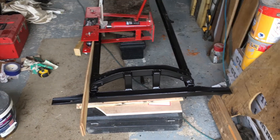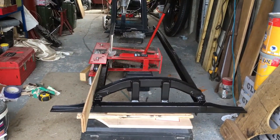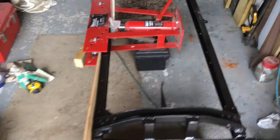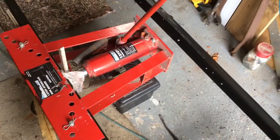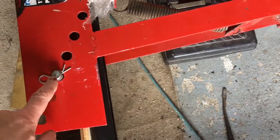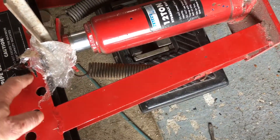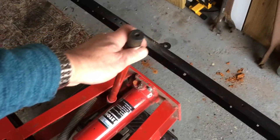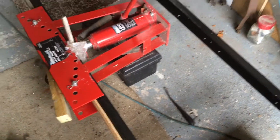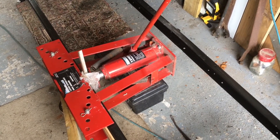I finished painting all the chassis the other day and stepped back and looked down the end and suddenly realised that one of the chassis rails was actually bent inwards, which is a little bit annoying to find out after you've painted everything. I've come up with this idea for strengthening it — I've got my standard tube bender here acting onto the inside of the chassis rail, with some wood plates to protect the paint. This pushes up and hopefully will straighten it up — you just pump on the handle like this, and I'm going to have to over-bend it slightly and then check it.